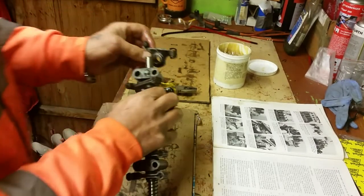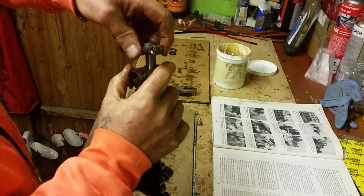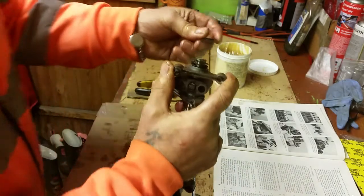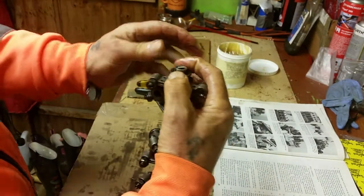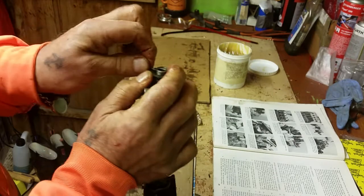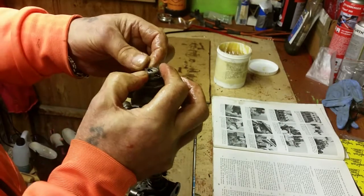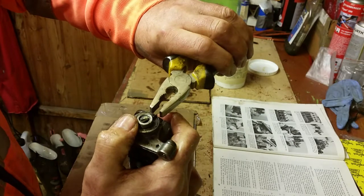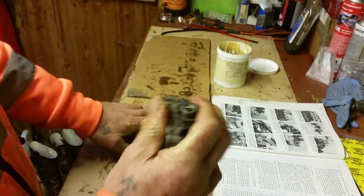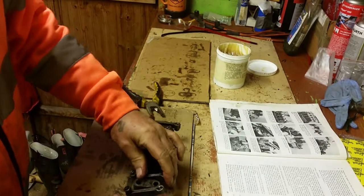We've got one more rocker arm to put on. We've got a little spring that fits on at the end of that. We've got our washer that fits on that, and if you look then, we've just got our split pin to put in. Now, slide your split pin in, make sure you bend it over, guys, don't forget to do that so it won't drop out. Split pin in so it won't come out. And that's our rocker assembly fully built up, that being in the right way.